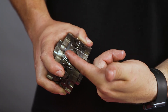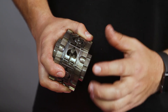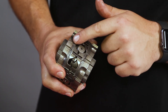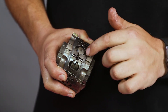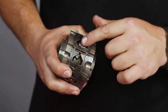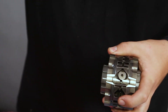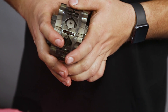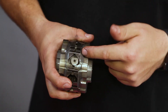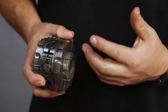This would be your one-way ramps where you have your flat side, then your angled side on acceleration. Then this would be your one-and-a-half way: you have your acceleration side with that steep ramp, and then you also have the ramps back here for under decel. You can see the angle and the way that's going to push apart — that's what's going to spread and push everything around. This diff doesn't have a true two-way, but one-way or one-and-a-half way is probably going to be our best bet for rally.